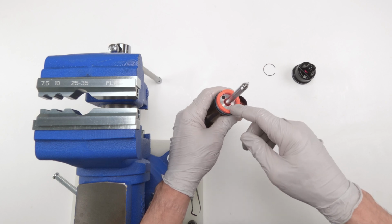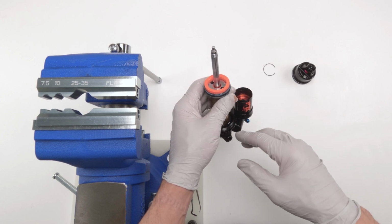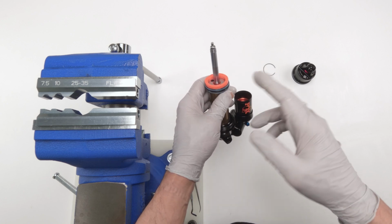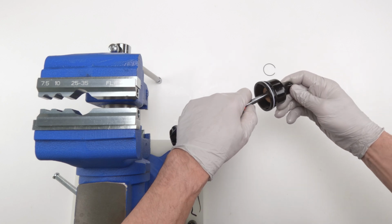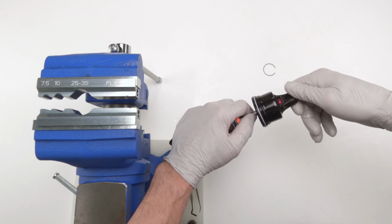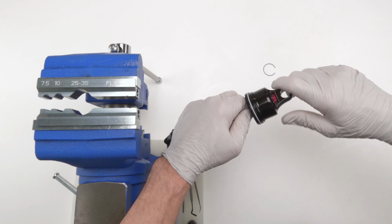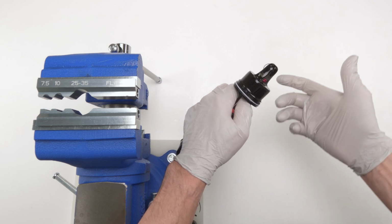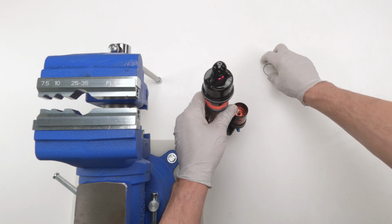Typically, the next step would be to remove the bearing assembly, but we're not going to be doing that. We're going to be filling up the shock with needles, syringes on both sides, okay? So our next step is we're going to put the cap back on, right? So hold on to the shaft, grab the eyelet, turn it. That's normal to hear the rebound turn. We're going to fix that in a bit, right? We don't need it tight.